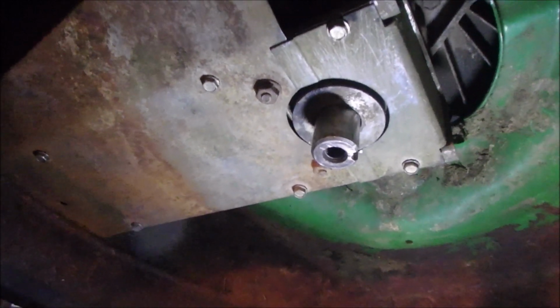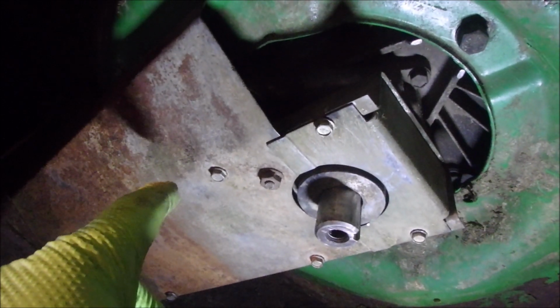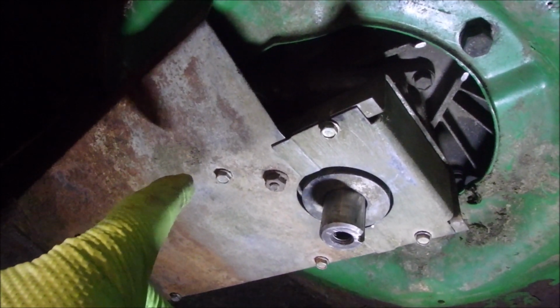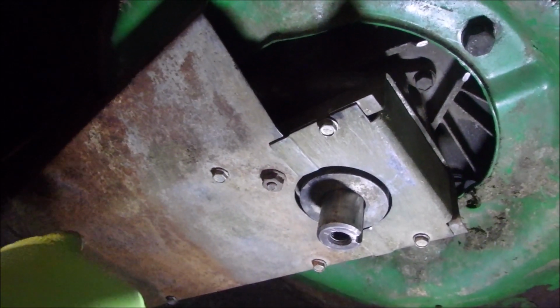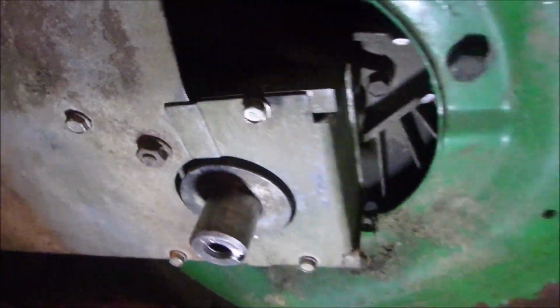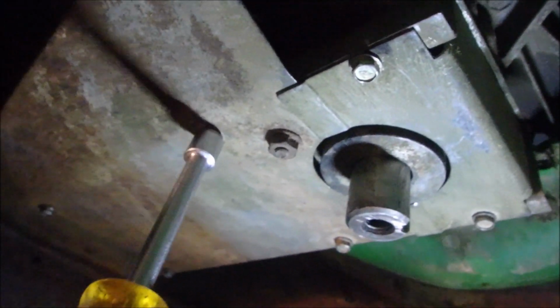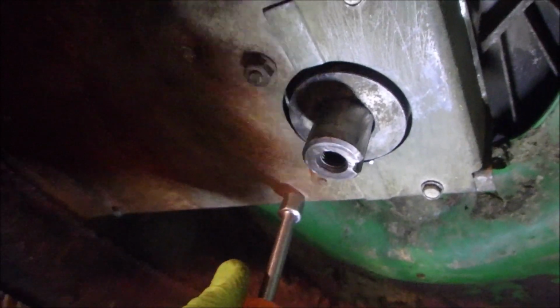So now I'm just going to put the blade on. Well, actually, a few covers first, right? All right, so it's just 2 pieces with 6 self-threading 5/16 nuts with lock washers on them. This piece went on first and this piece went on over, because there's an overlap there, second. And I haven't confirmed the tightness, and I am just going to do that now as we work away here. Oh, they're good. Just a half a turn on each one. That's so great. You know, I'm starting to trust that after a year.